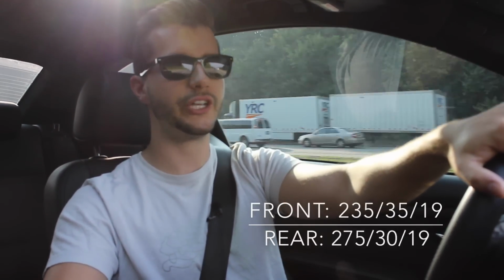There's a calculation tool where you put in the size of your current tires and wheels, and then the new ones you want, and it'll tell you exactly what difference it'll make as a percentage. Then you can calculate, if you drive 10,000 miles a year and mine's off by 2%, that's not a lot of miles that are off. So that's definitely doable. I'm not sure if there's a rule, but people would say under 5 or 10%, you're probably fine. It just depends.